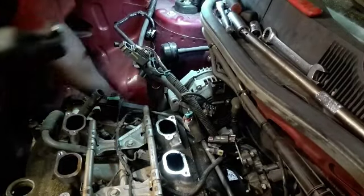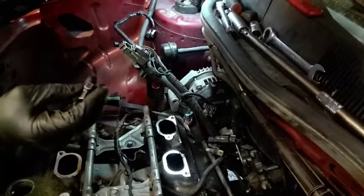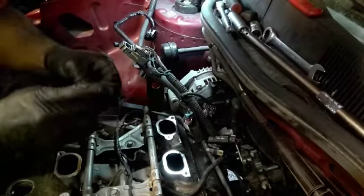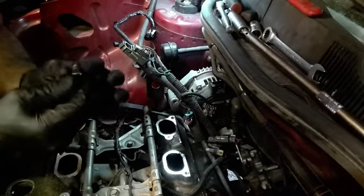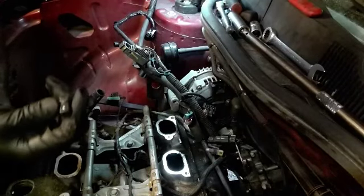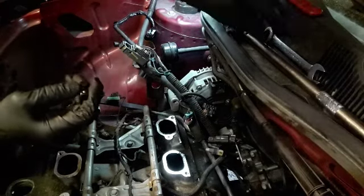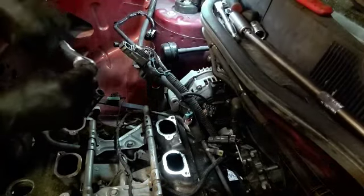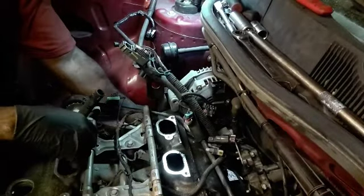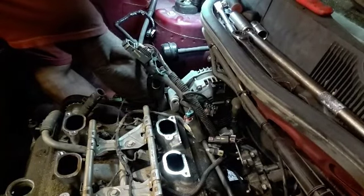This is going to work. What I normally do in tight spaces, I got these little stubby ones here from Harbor Freight. They work very well in tight places. I can slide this into the 3/8 square side for the tensioner, where I can't normally get some of the other tools, and I can use a ratchet wrench. Now I got plenty of angle, so I can pull the tensioner. I'll just leave it in there until I get finished and pull it back out. That's what I normally do with tight spaces.